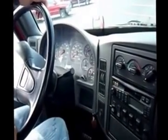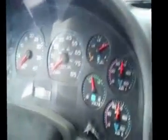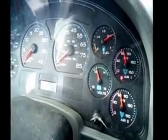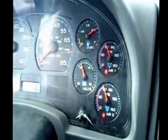Now I'm going to pump my brakes down. I'm going to get my warning indicator to activate. It's going to happen above 60. There they are. That happened right at about 60 psi.